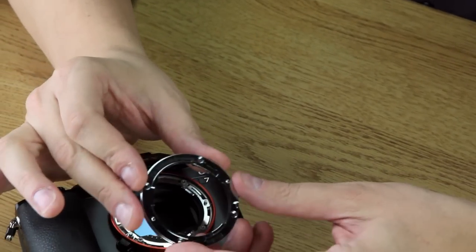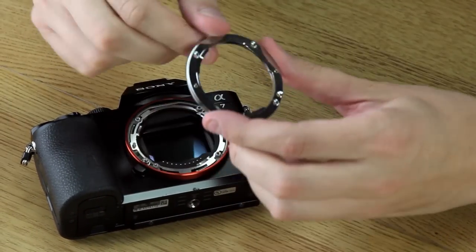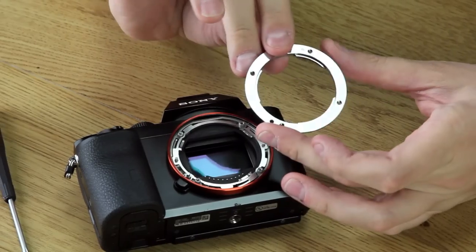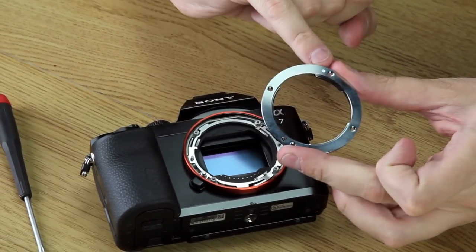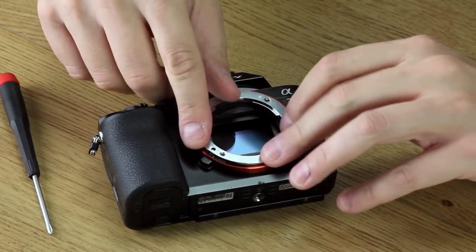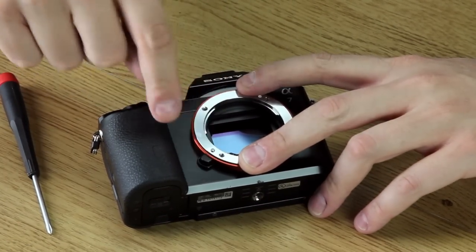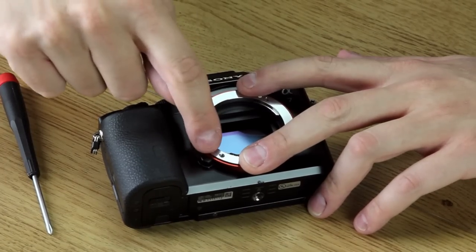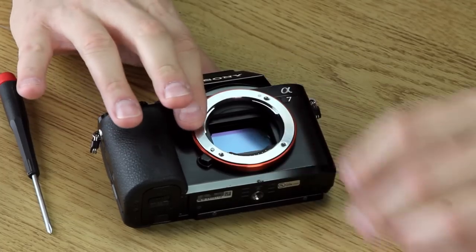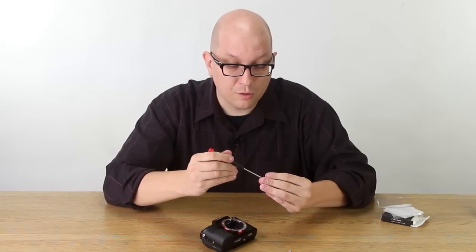Those are now junk. We're going to get out the TUF E-Mount now. Here's the TUF E-Mount — it actually says it right on the mount itself. The way we register it on the camera to make sure it's facing the correct way: remember the white dot is at one o'clock. So just make sure that you line up the screw holes with the dot up there, and make sure that little button sticks out, because that little button is what locks the lens on in the first place. Once you've got it firmly seated, you don't have to use a lot of force.